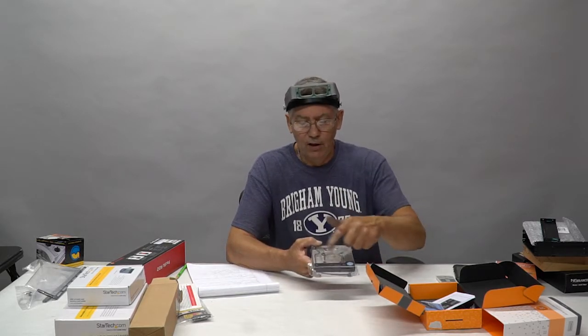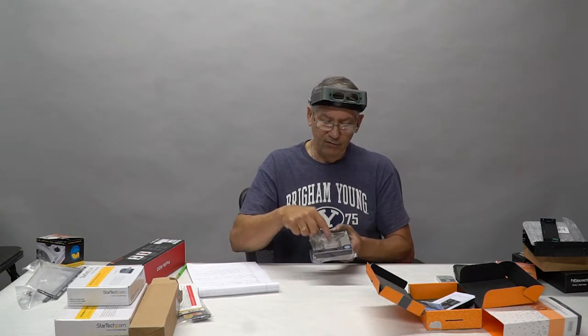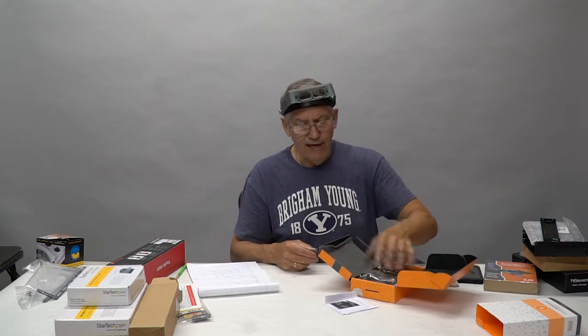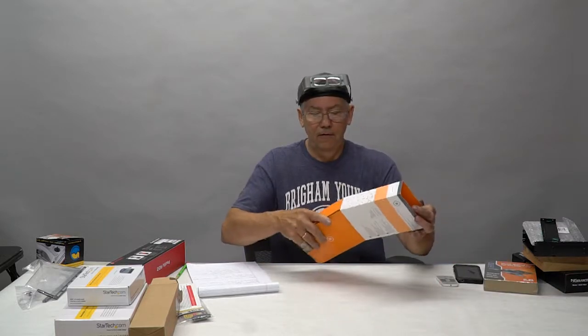It's an active cooler, so I've got one with a clear acrylic top, polished nickel back, so that the fluid comes in, it circulates around through everything and cools everything down. So instead of having a fan on our VRM, we're going to run an active water cooler on that as well. It doesn't require any more plumbing, it's just one nice integrated block that fits on there, and there's no moving parts in this at all. It's just a heatsink that gets cooled off with the water from the radiator. Now, water from the radiator, that brings us to a couple of things.